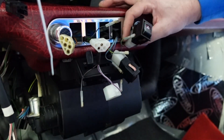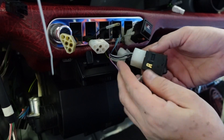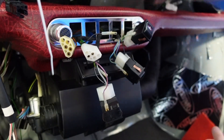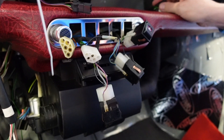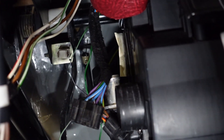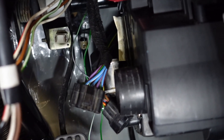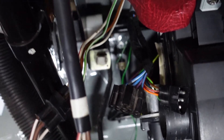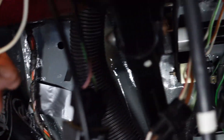I think the earth is on the left on these, but I'm not going to push them back into their holes until we've got the rest of the circuit in place so I can actually test them. I've also noticed I bought the wrong switch — I bought the secondary one for the lights, not for the headlights, so I need to order a new switch for that. You can see the brake sensor cables here that attach onto this — there are two of those, one for either side. This is for the ignition, indicators, stalks, and these two cables are for the roof. They clip into the harness and we are ready for the dashboard.